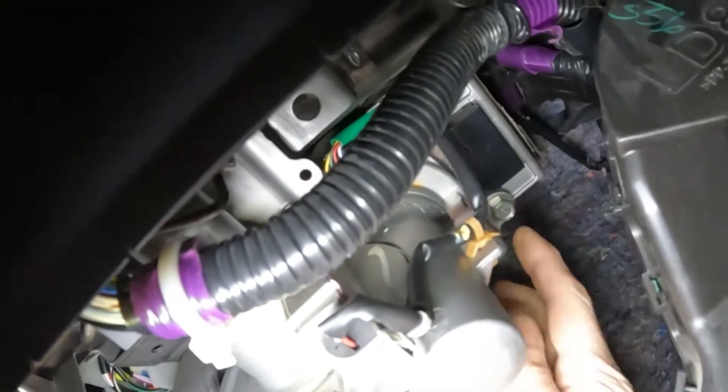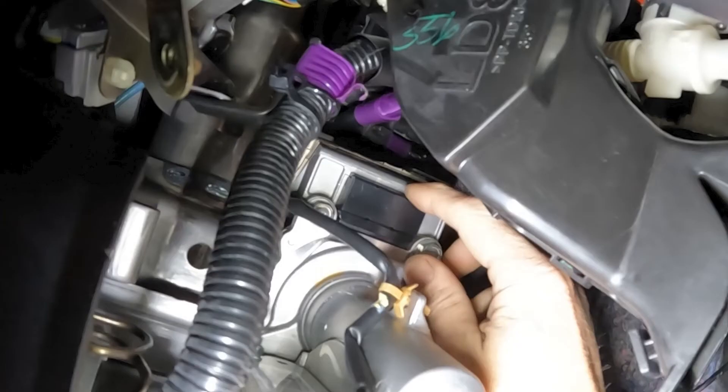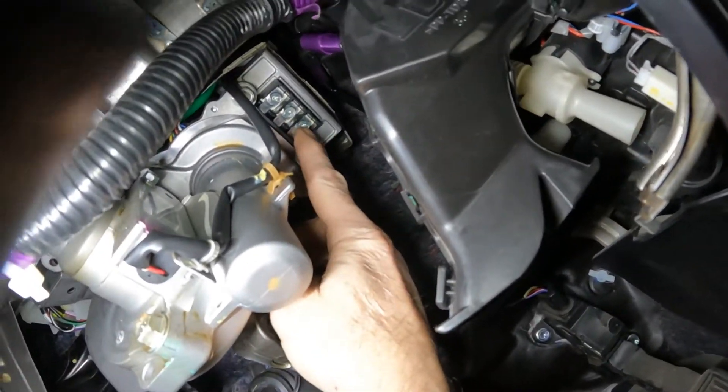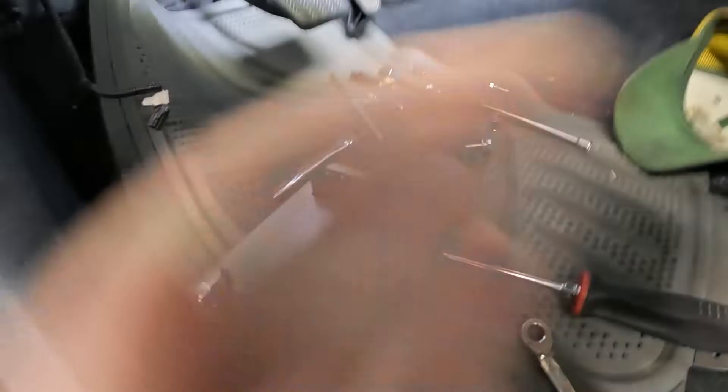Here's how to get that ECM in and out. The ECM is right here, bolted in with just two pieces of hardware — one here and one here. This plastic cover needs to come off, exposing how it buses into the actual motor. There are pigtails on the back that are a bit of a bear to reach in the car. Once the cover pops off, it exposes the bus bolts — 8 millimeter — so just take those off and the old computer comes out.